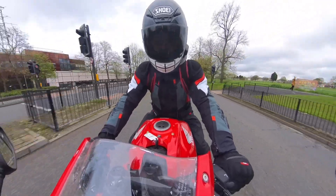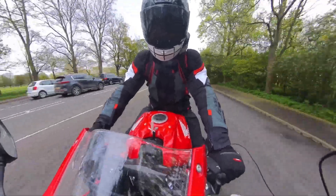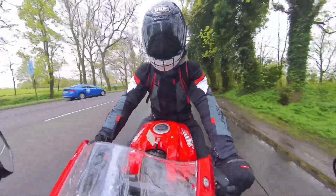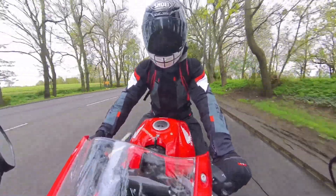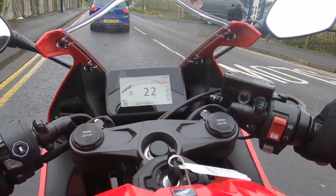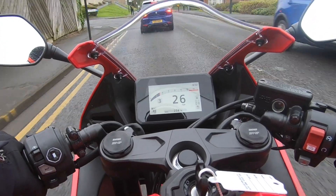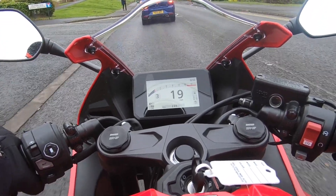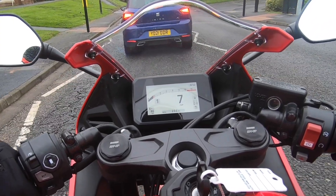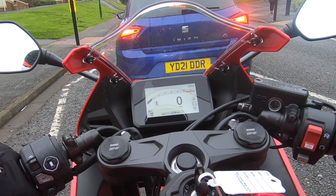And we're off — and that's where this system is mega. That's just away from the lights, no hassle, boosh gone. As I just mentioned, if you're in the wrong gear — so if you're labouring it — it will flash on the gear indicator to tell you to change down. You'll see it start to flash in a second. It flashed there to say change to first. It won't stall because it just pulls the clutch in for you, but it does make it hard to pull away if you're in the wrong gear.